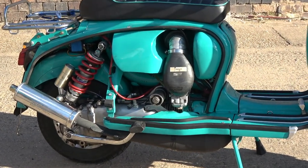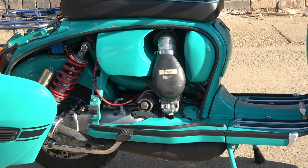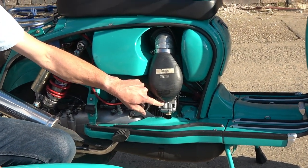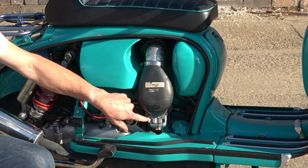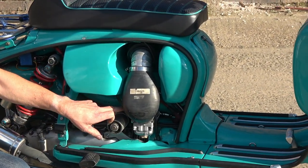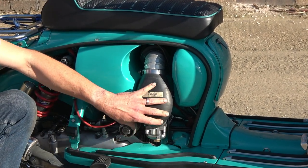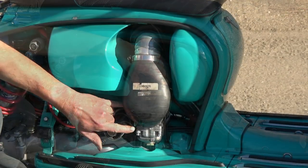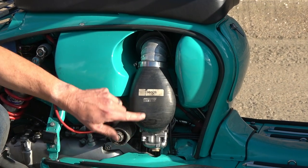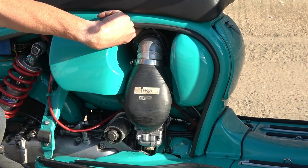Panel off — you can see a few changes around this area. One of the things I wanted to incorporate was an air filter to keep muck out of the carburettor. The carburettor is a VHS-H30 30mm carb, so not too big given the capacity of the machine. The bellows have come from Subaru — a nice 63mm that clamps straight on. I made up a little angled adapter and the air filter sits effectively where the air filter does on a standard Lambretta.